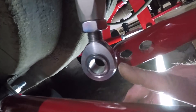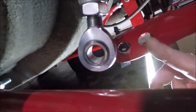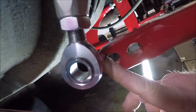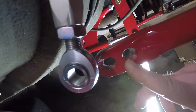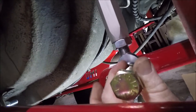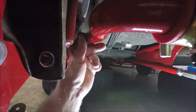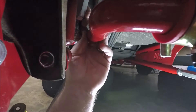You're going to notice the sway bar actually has two holes — that's for two stiffness settings. If you use the closer hole, it will actually make the sway bar act stiffer. If you use the hole further out, it'll make it act not as stiff — it's just a leverage thing. For drag racing, you want it as stiff as possible, so we're going to mount it to this closest hole right here. UMI says to run the bolt in from the outside of the car, so you want the bolt head on the outside of the car and the nut on the inside of the car.